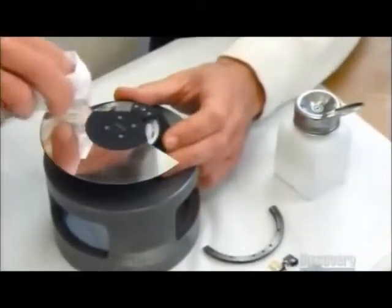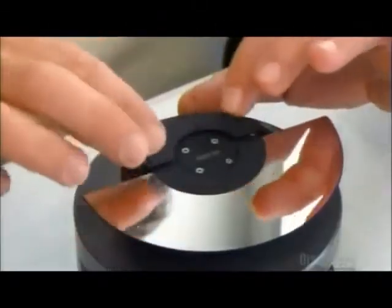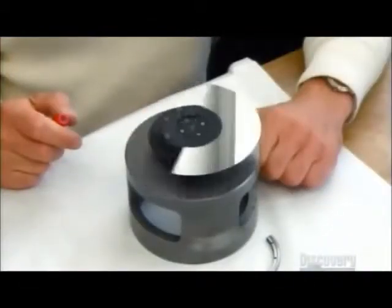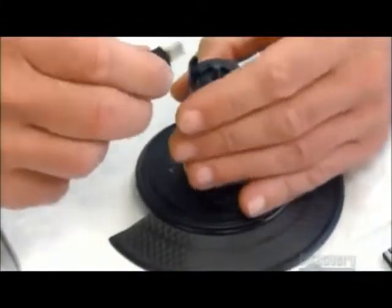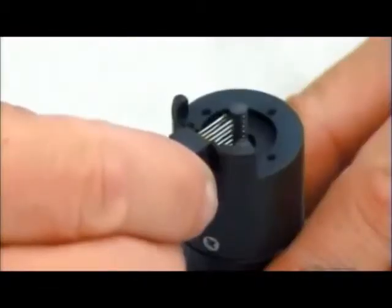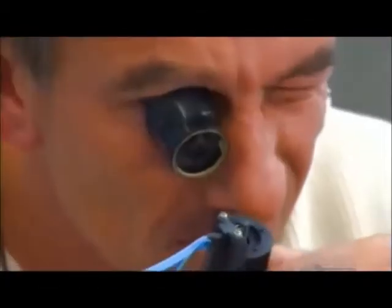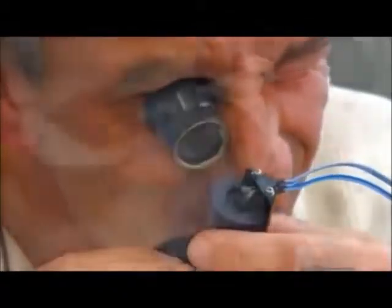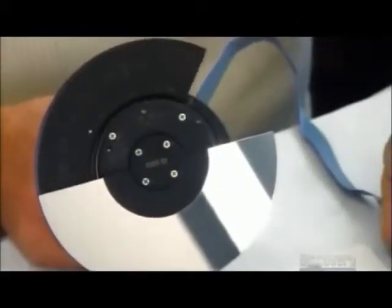Any dirt on the mirror would create a fuzzy image. The protective cover plates will shield existing openings. Here, the shutter and mirror spin in unison. In this model, the shutter is electronic, so it requires a tiny microchip and electrical wires with plugs on the ends. Technicians scrutinize the parts and connections, then test the electronics again to ensure everything is working, starting with the shutter.